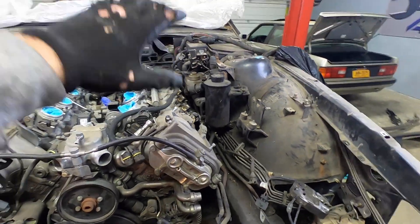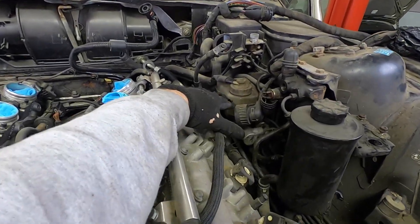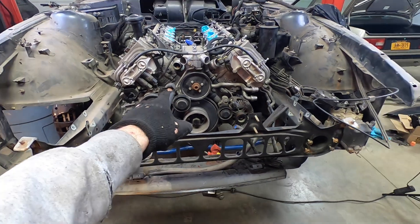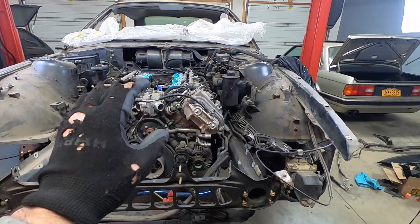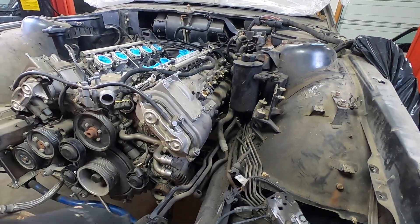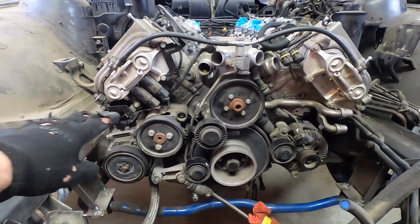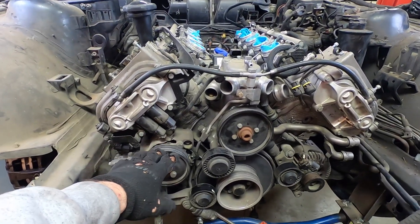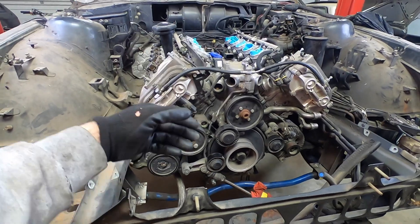There's a lot of stuff going on in here. The plumbing for the Hydro Boost is incredibly complicated — you have a regulator, a reservoir, your master cylinder, your actual Hydro Boost module back there against the wall, and your power steering pump. The power steering pump on the E31 M70s, E32s, and E34s is a tandem high pressure output, which means it has two high pressure outputs: one goes to the rack for power steering, and the other goes to the Hydro Boost system. Given that this power steering pump is literally buried in the engine and it's only a single high pressure output, I don't think I'll ever be able to retrofit a tandem high pressure output on this S85. That is just about the game changer for me.